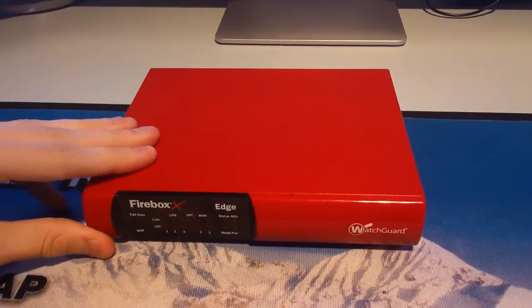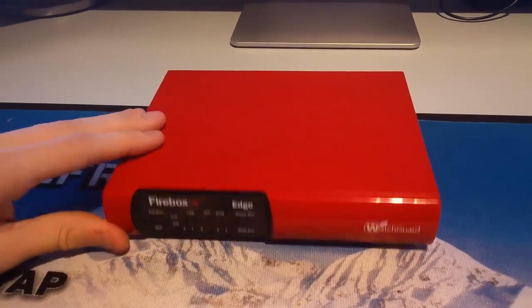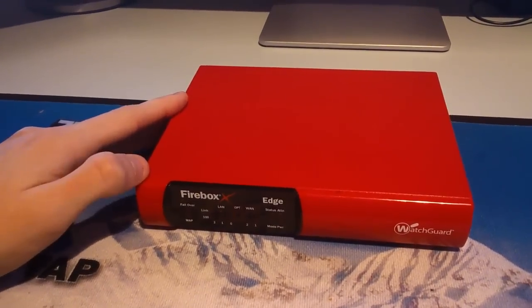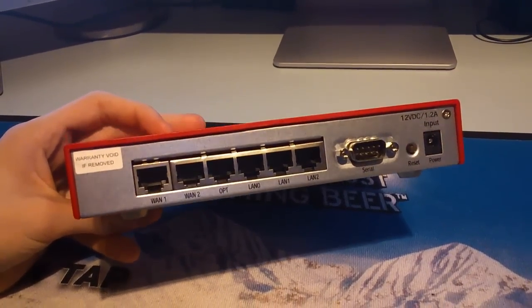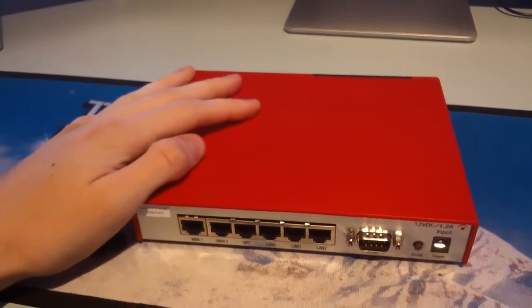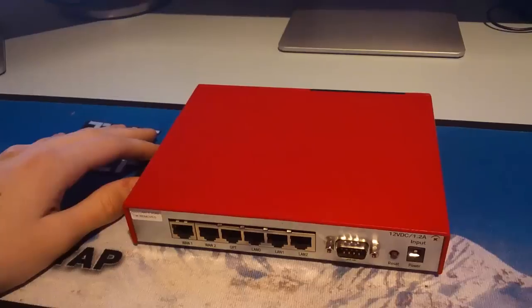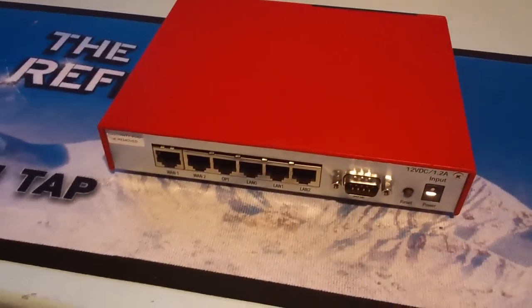In the next video I'm going to show you how I hook it up. I actually bought a modem, because this thing can act as a router. I bought a modem basically because my main internet connection into this house is ADSL2, so I needed to convert ADSL2 into RJ45 to give me the cable connection needed to plug into here — without having to go through my current router and deal with double NAT. I got a new modem, putting it in bridge mode, and then I'll be able to do all the PPPoA on here since it's over ADSL. Pretty much that's really it on the review — see you guys in the next one. Take care.